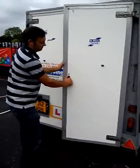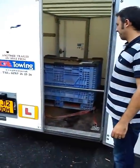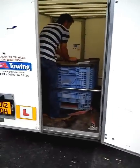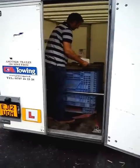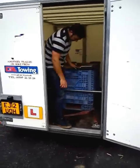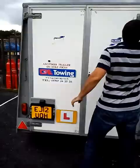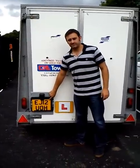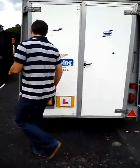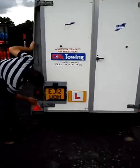We then go in the vehicle itself. Remember, you must have a load in the trailer which weighs 600 kilograms. So get yourself in the back of that trailer — check it's all nice and secured. Once that is done, hop back out. Just check the door hinges and make sure they haven't eroded. It's important that you tell the examiner that you've had a number plate made up to match that of your vehicle — some examiners will ask you that question, so make sure you point it out to them. Don't wait to be prompted.